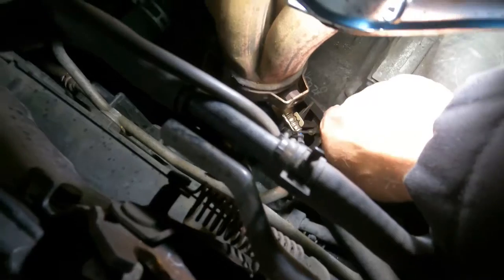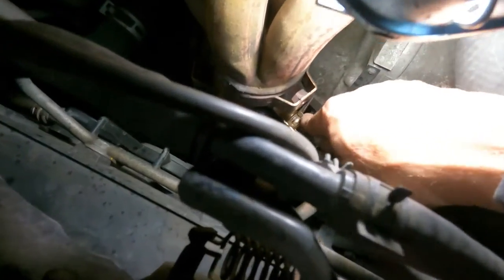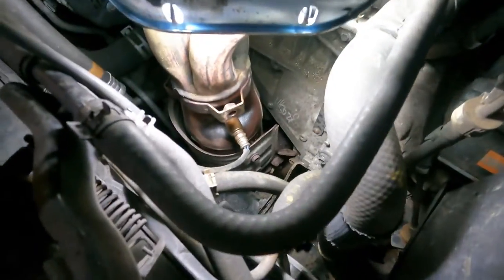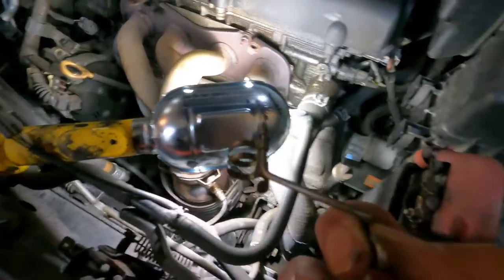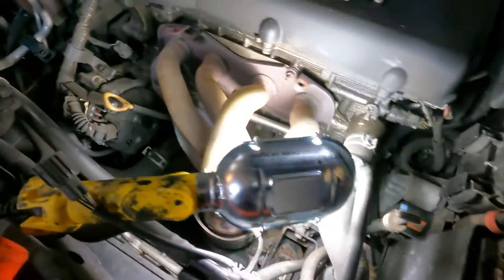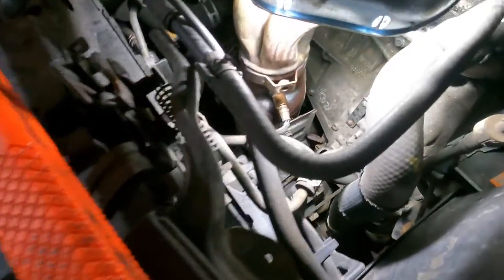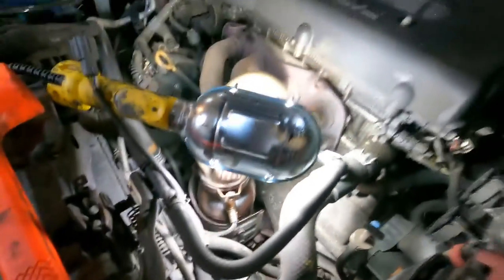The little wire holder down here — I pulled the wire/cable out of it, and it just spins. Looks like it's just kind of spring-loaded and it just pops off. So now we're ready to get the O2 sensor out. We've got our little spring clamp out; we'll pop that back on when we put everything back together to hold the wire away from the heat. Once I figure out how we're going to get this off, I'll be back.